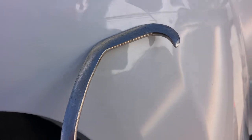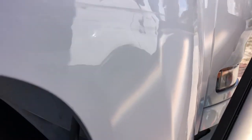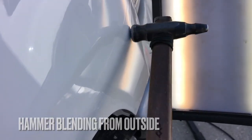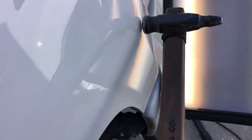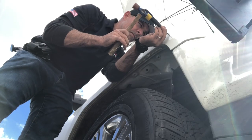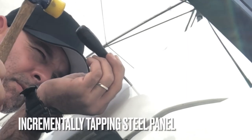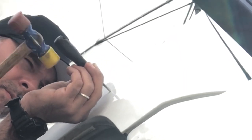This is what one of those tools looks like — that's actually a finishing tool. We use that towards the end of the repair to kind of manipulate and fine-tune. We're also doing some hammering from the outside, as you can see here. The hammering allows us to incrementally move that metal really finely and just dial this thing in nicely.